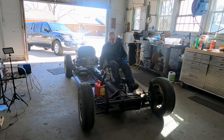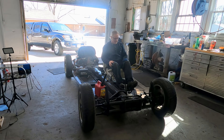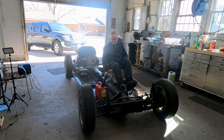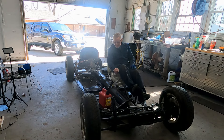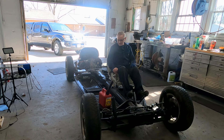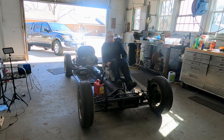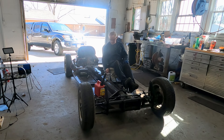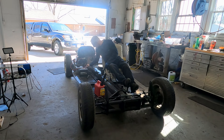I've always wanted to do this — on a Volkswagen the pan will run independently with the body off, which is why so many people use it for kit cars. If I had the steering wheel hooked up with some sort of brace I could drive it down the road — it's perfectly functional on its own. What I'm doing here is testing the clutch and the brakes to make sure everything functions before I put the body back on.